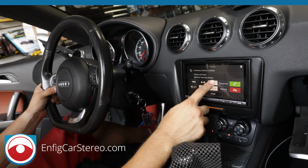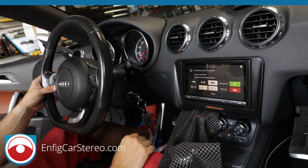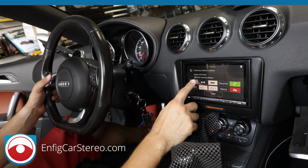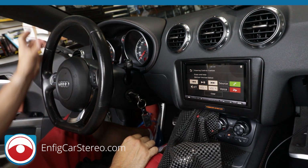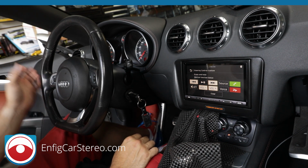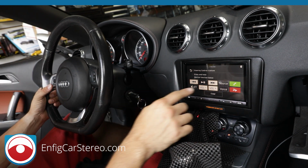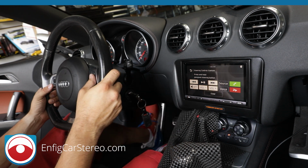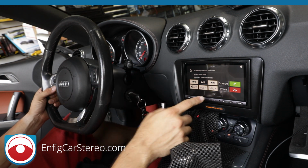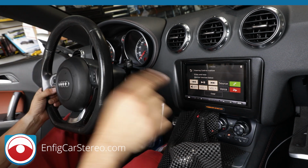Now we're going to do song up, that's the other one, and then song down, and it's programmed. Try to do a nice roll. Sometimes it won't take it. You might have to do it twice. All right, so now we're going to do mute. We're going to hold down the mute, and we're going to push in on the volume button, and that programs mute.